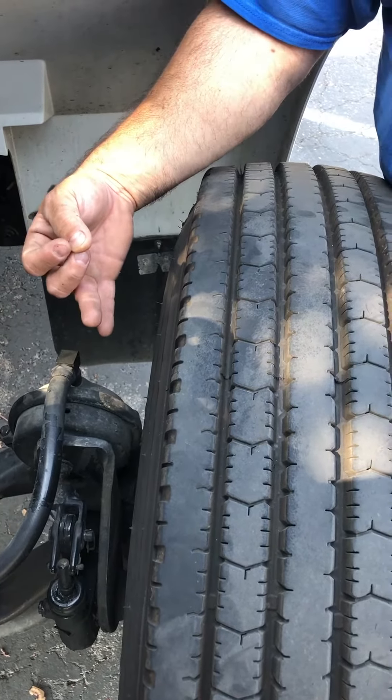And that puts me on my rims — inside, outside, no damage to my rims, no illegal welds, no shiny threads on my lug nuts telling me that they're loose, or rust indicating that they're damaged. I'm also not missing any of my lug nuts. My hub seal is secured with its proper hardware and it is not damaged or leaking. My valve stem is also in good condition, not damaged or leaking, and the cap is on.